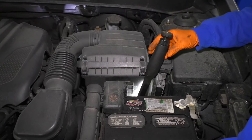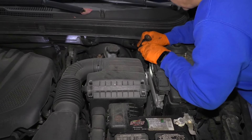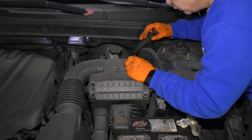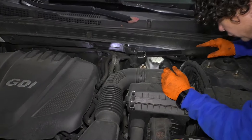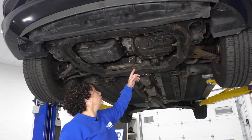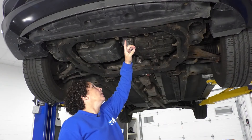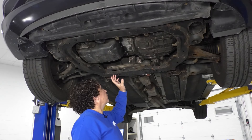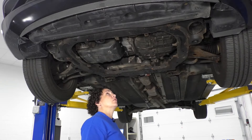It's kind of hard to see, but I can visually see it from here. You can take the air box off and give that a good look. Then you've got the right side engine mount, which you can see very clearly from here, and it's fully intact. Now we can see underneath and we can see the motor mounts — the one on the rear and the one on the front here by the radiator. The rubber's not ripped, steel's not ripped, there's no crack, and the welding didn't come undone. So we're all set.